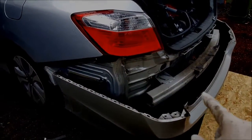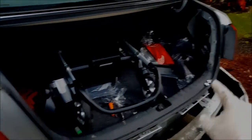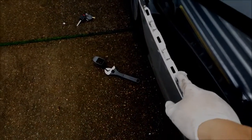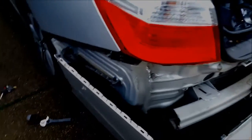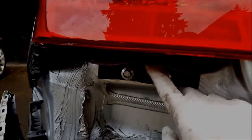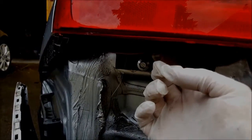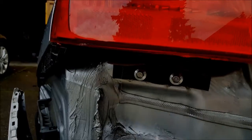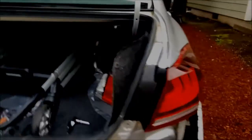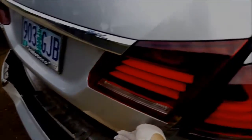There are two screws over here, two plastic clips on the bottom, and two hex screws on the side. Once you get that out, you just kind of yank the bumper — it clips on from here but once you get it free the bumper just comes off. The tail lights are actually bolted on here, so you have to remove the bumper to take off the bracket screw and then the tail lights just come out.